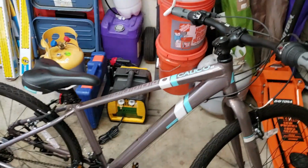All right, well I got everything buttoned up, put back together. Got the system recharged. It looks like that valve was the problem, so it's blowing cold air right away. The pressures aren't exactly where everybody else or normal standards say they should be. Maybe it's the temperature outside today, but I did wind up putting more refrigerant back in. It probably has more than what the system calls for. I don't really know, because I don't have all the professional equipment to do it with. I mean, that stuff is pretty much professional equipment, but I'm not a professional.